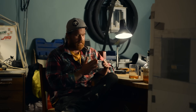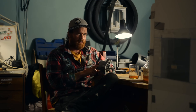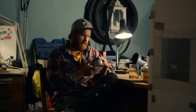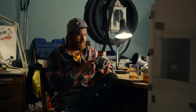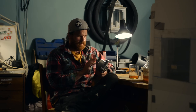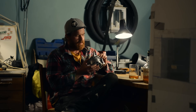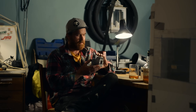The cylinder — I've honed it to be 39.90 millimeters in diameter. That was what was needed to achieve a good finish and a pretty nice crosshatch. I'm getting better at the honing, and the battery-powered drill helped a lot.